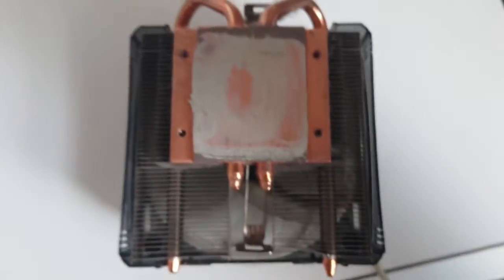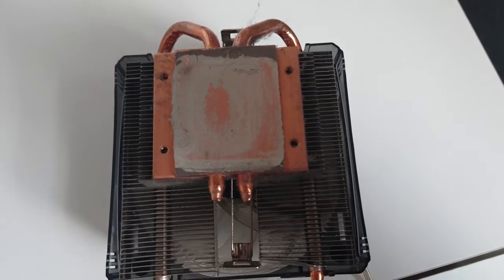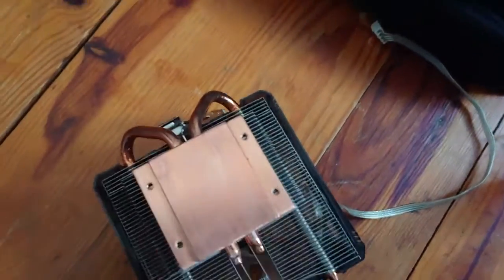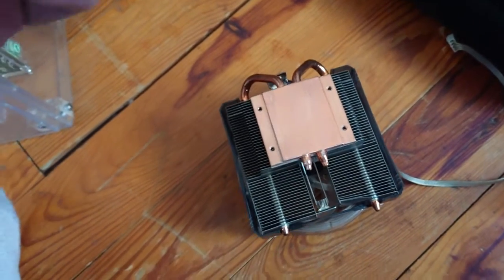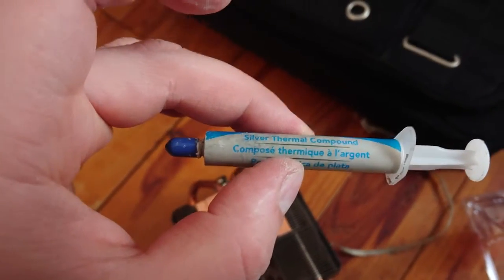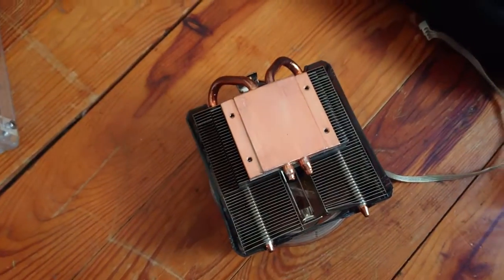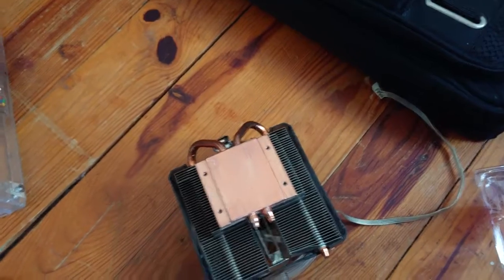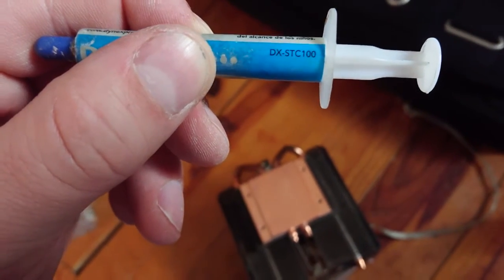So I lied — the gunk also gets stuck on top of the heat sink on the old CPU fan, so I'm going to have to go ahead and clean this off before we install the next CPU. So I cleaned off the old gunk. It's not called thermal gunk — it's actually called silver thermal compound. This is a heat transfer compound that creates a nice even surface between the heat sink and the CPU and helps transfer and dissipate heat. This is the product ID and code of the stuff I use — I bought this at Best Buy a long time ago.